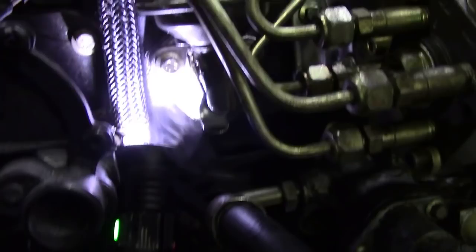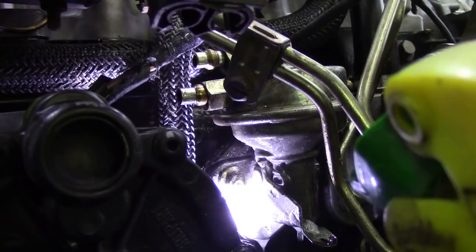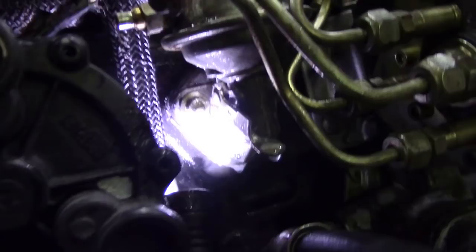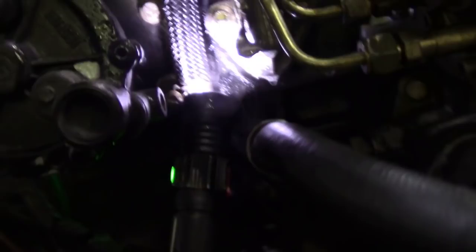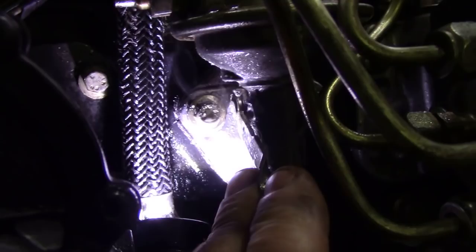But there is a leak we've seen before — it's something that can be a mysterious drop of oil coming down onto the sump and you think it's the sump gasket. You can see it's coming out of the fuel pump. It's difficult to see exactly where, so I'll squirt some water on it. If you look very carefully it's coming out of the shaft. You can see where it's coming out — it's coming out from below the shaft. That's our leak.